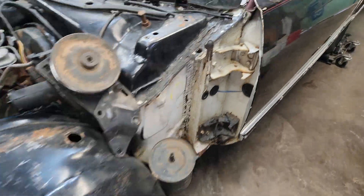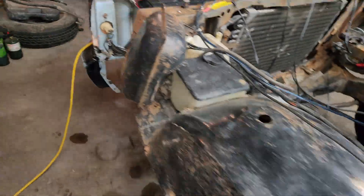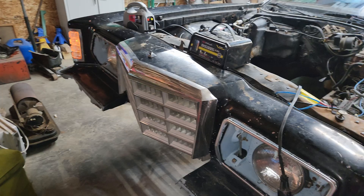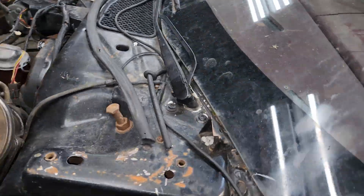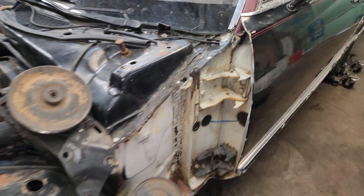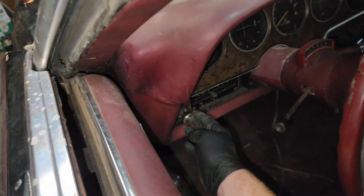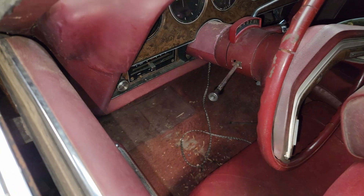Let's circle back around and get the headlights. The taillights are all missing, of course, but we do have front running lights. The headlights might just be burned out — I'm not really sure. The wiring seems to be intact enough to not cause issues. Left blinker works and the right blinker works. I will have to plug this headlight switch into my other Thunderbird to test the vacuum part, because if the vacuums are gone it's basically useless.